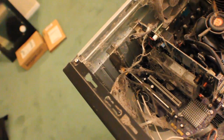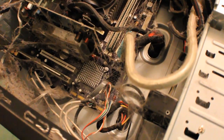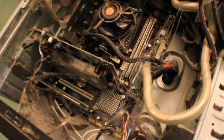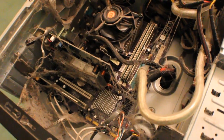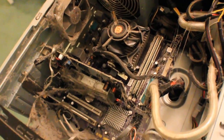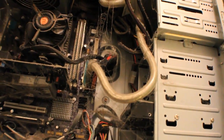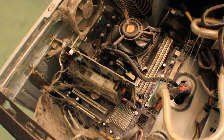With this amount of dust it's actually better to use the vacuum part first and try to vacuum as much as you can. Be careful not to hit capacitors or anything like that — don't just jam the hose in there. Vacuum first because if you just start blowing you might push stuff deeper into sensitive electronics, especially in the power supply. When it comes to laptops especially, you really want to vacuum rather than blow.